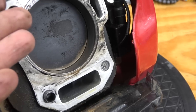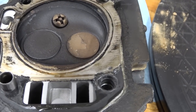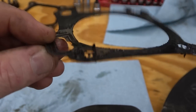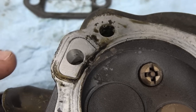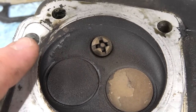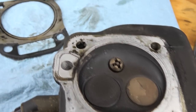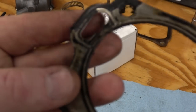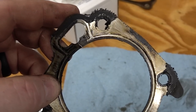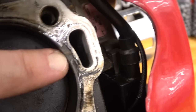Who knows? Where's that piece of block — did it hit the piston? There's a little mark on the piston. So basically, pulling this out for the first time, you can see right there it just shattered all the way through. And there's a lot of soot buildup where it was blowing, and it's letting oil in here as well. But we weren't smoking really that bad out of the exhaust. So I don't know what fell first — the head gasket or the block. I would say the block chipped like that. It's split — that's a wall hanger. It just fractured the block.